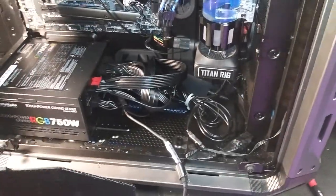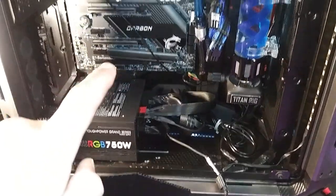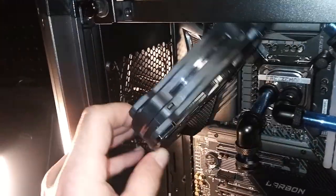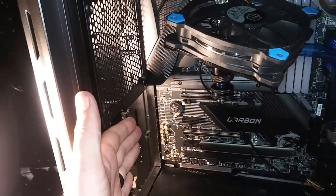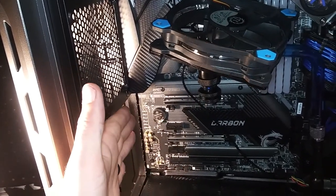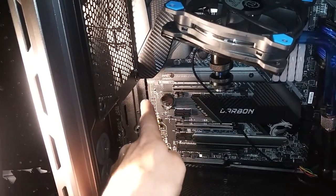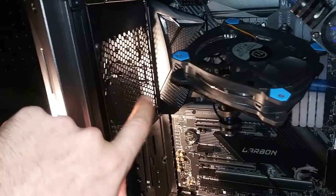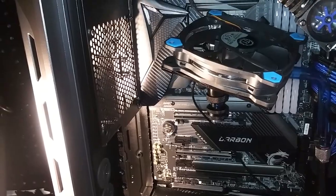So I had no choice but to completely tear it apart to get that screw and get the M.2 drive finished in. One thing I very quickly realized was that I had to remove this exhaust fan here because the GPU's top bracket wouldn't allow it to come out. I couldn't just pull it straight out because of the teeth that go down into the side — I had to actually lift it and then pull it out, and the fan being there wouldn't allow that.